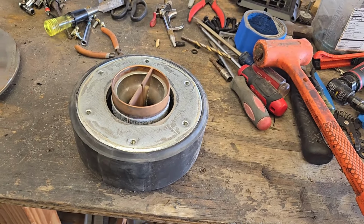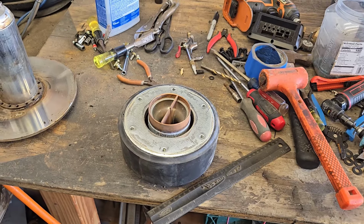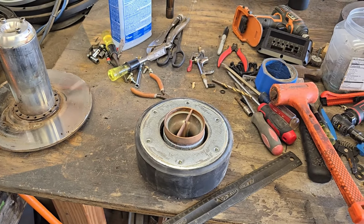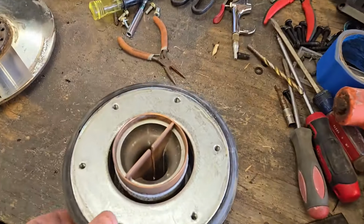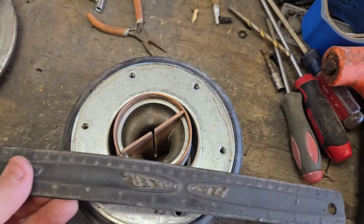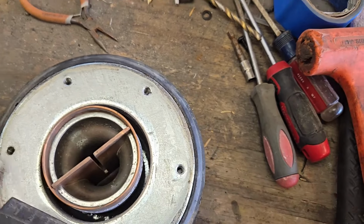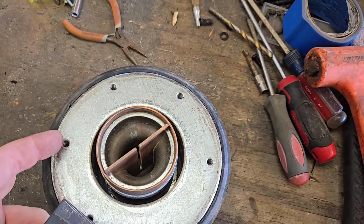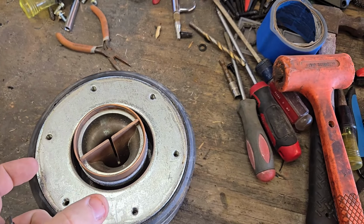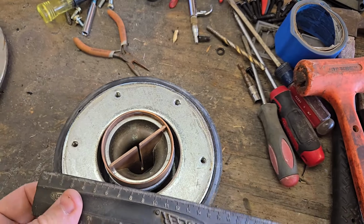Let's measure the bolt hole circle. One of the other numbers that's important in sending the gap dimensions is knowing the BHC, the bolt hole circle diameter. Basically what you do is you measure the two far apart from one another. Now most of these motors are made in China, and so you want to go center to center, or you can go left side of the bolt hole to the left side of the bolt hole. That's another way to do it. If you have calipers, that's the best way to do it. But most guys will just go center to center. You just kind of eyeball it.